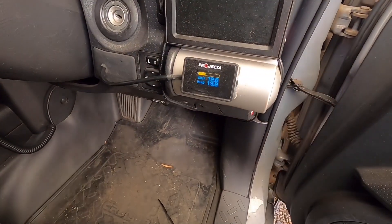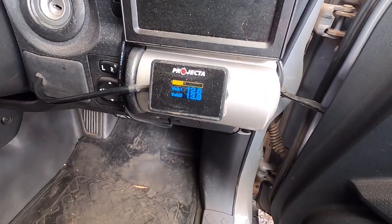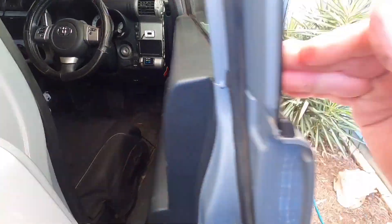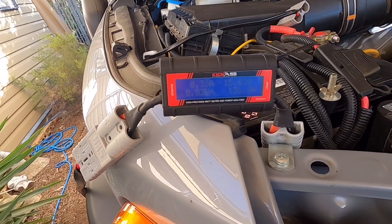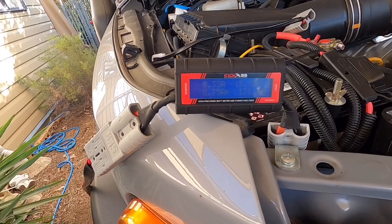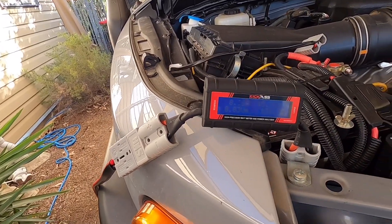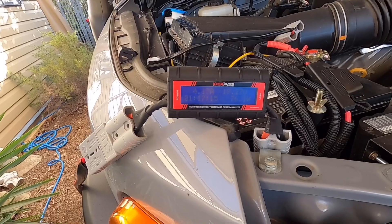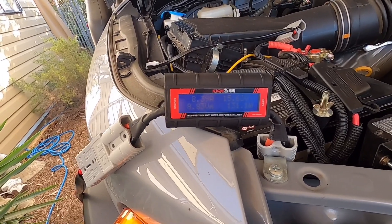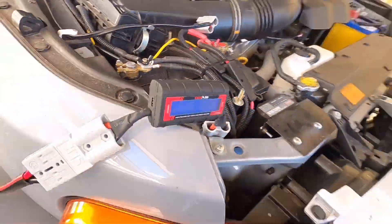It's just on nine o'clock. The fridge is cycling - I can hear it in the background in the back of the car. She's just sitting on 13.8 to 13.9 volts. It's putting in 130 watts, 8 amps, 15 volts. The voltage drop is probably because of the long cord - if maybe you had it at five meters you'd probably find it putting in around 20 volts. As I said, it does jump up to 18-19 volts at times. Really happy with that - everything's going great with the Kick-Ass solar panels.